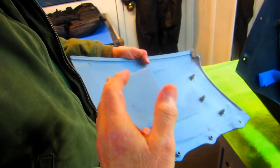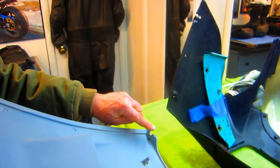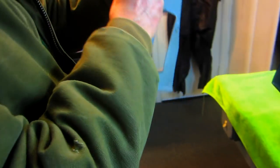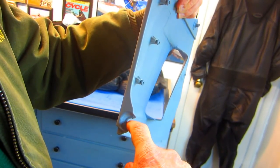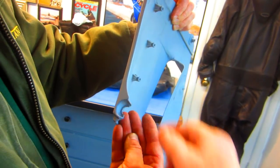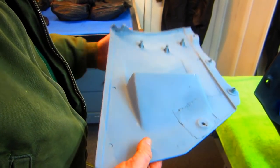I've got to figure out this mount - it's a full round and there's a bar that goes across to the other one, and it gets a screw through it. What you can do is get a washer that fits in here, drill the hole the right size, epoxy the washer in there, and then build the back up with CA. Once you get a washer in there, that makes sense.